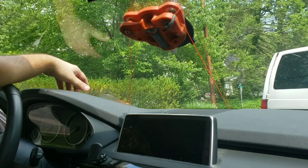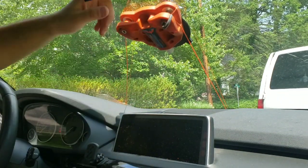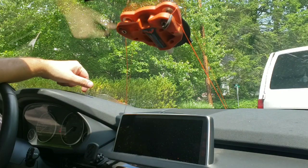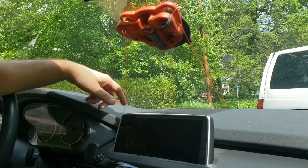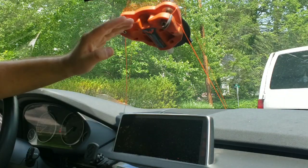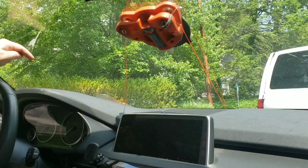So I'm working on a 2017 BMW X5 with a windshield that has a rain sensor only, and I'm gonna be cutting this with the orange bat. The way I start cutting with this tool is I start in the middle, right here — I poke the hole in the middle and set up the line like usual.